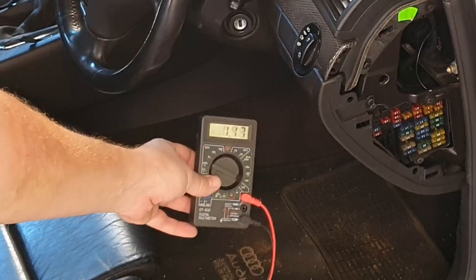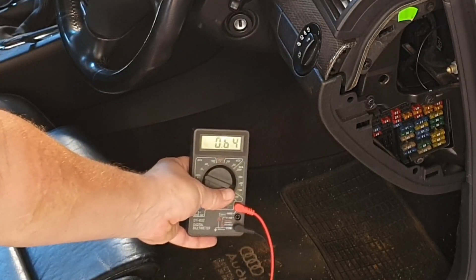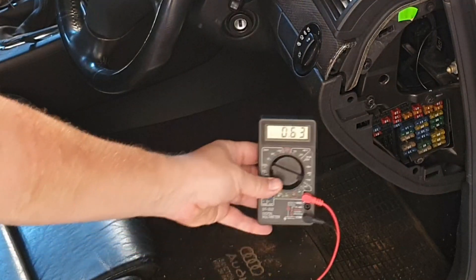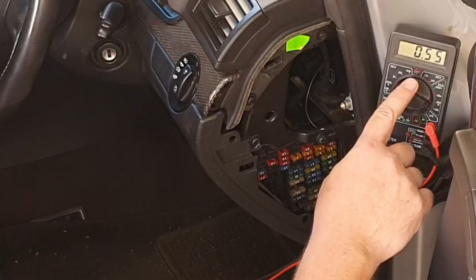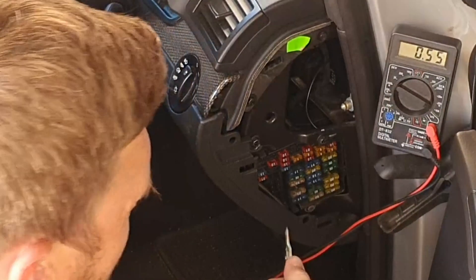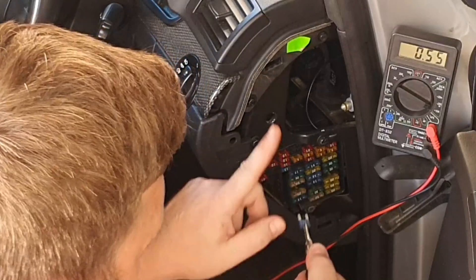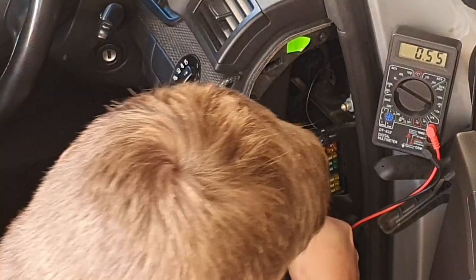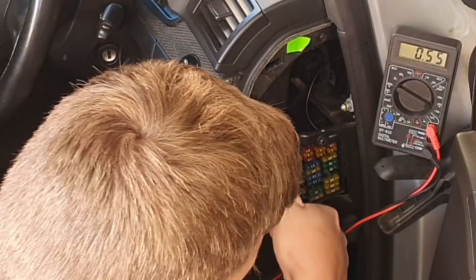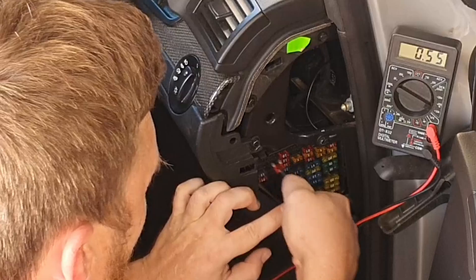I've now connected the two leads still on the 10-amp function, and you'll see it once again goes down to about 0.64 to 0.65 amps. I've put the multimeter up here so we can clearly see the reading throughout the whole time I'm going to test the fuses. To test the fuses, I'm simply going to take out a fuse and see if the reading changes — in this case it did not. Going through all of them — still no change. Let me put this in fast forward until I find one that makes a difference.